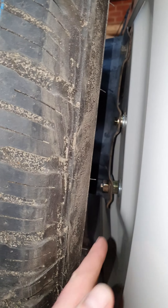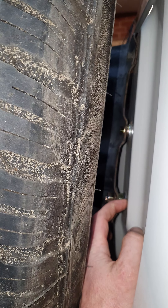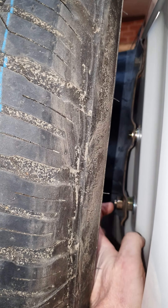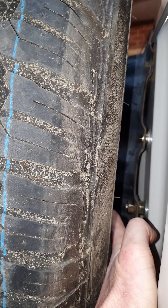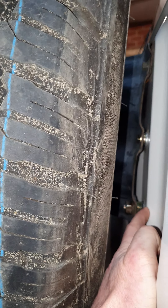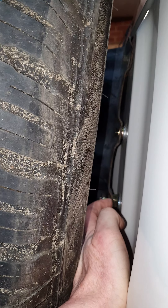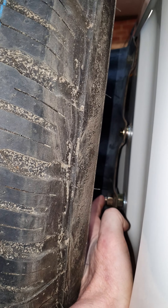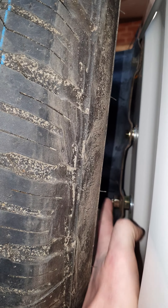What I found is that an M12 will actually cut its own thread into this sheet metal, so I actually cut the thread and then set the bolt coming out from the inside. It's threaded into this sheet metal which has got some thickness, not massively, but you get it just as tight as you can and it won't tend to spin - it hasn't spun on me at all yet.